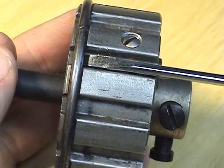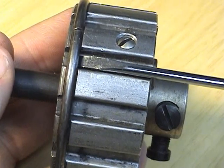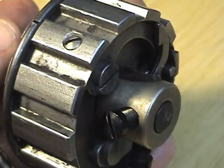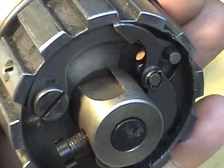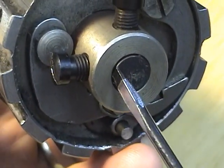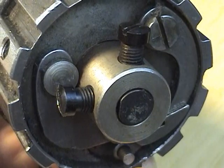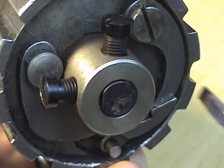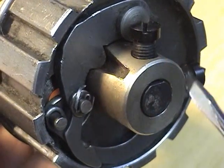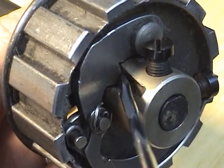You can actually do the adjustment I'm showing you with the timing belt on; however, it's a lot easier to do with the timing belt off, assuming you know how to get your machine back in time. I'm going to go over a few of the parts. Here is the end view — this is not a shaft out of a Singer machine, just a shaft of the same size with a flat spot on it, which was more convenient for demonstration. You've got the set screw that goes on the flat of the shaft, another set screw, a series of metal curved pieces, a hub that surrounds the shaft, and this is your safety mechanism right here.